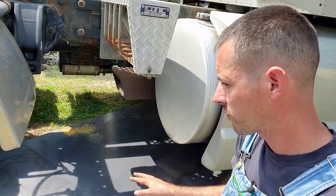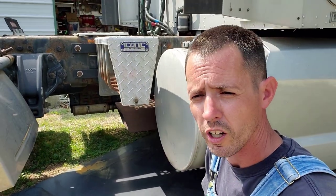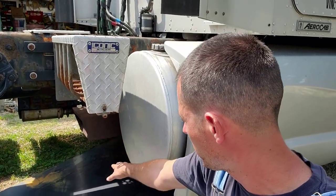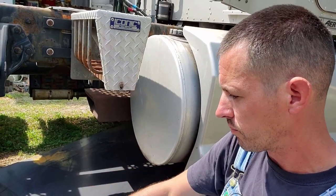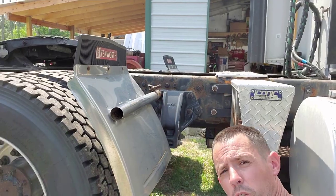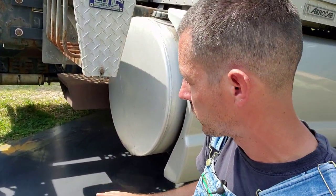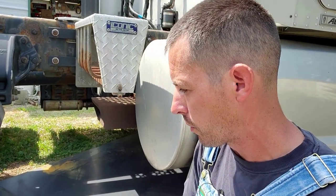So I've got a pretty nice hard packed driveway here, pretty level for the most part. I got 1 sheet up towards the front underneath the transmission. Then I've got them overlapping with the overlap coming down to this piece here. And I'll explain that reason a little bit more in depth in a second. So this is a nice smooth surface, probably even better than doing it on concrete for the most part, because it's a perfectly smooth surface. So it'd be real easy to move the jacks around on. And this is thick enough that it won't ripple or anything like that.